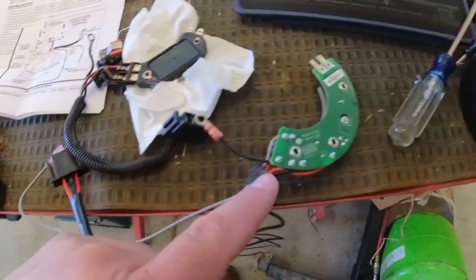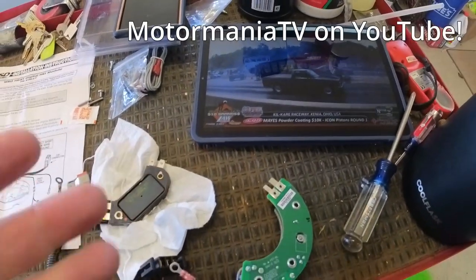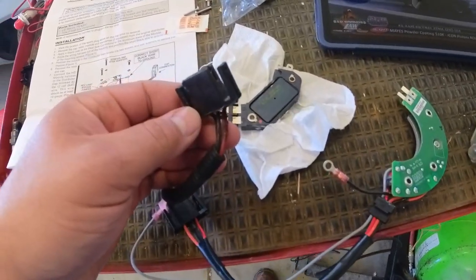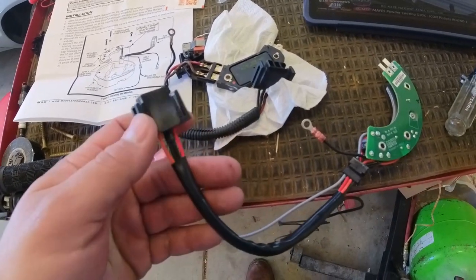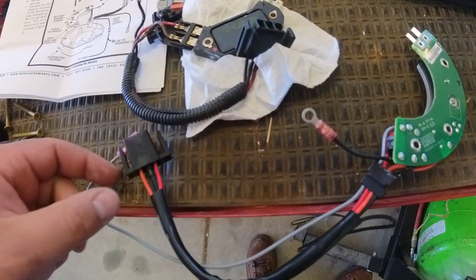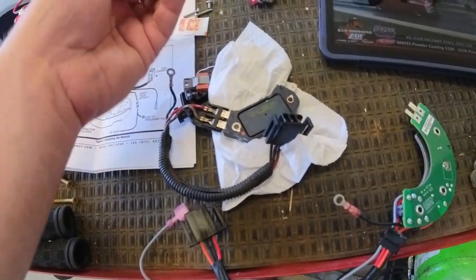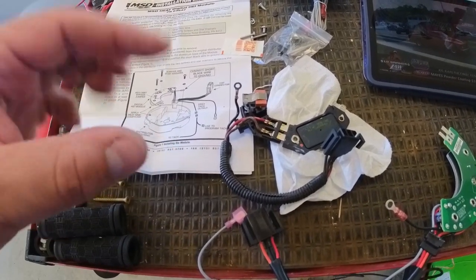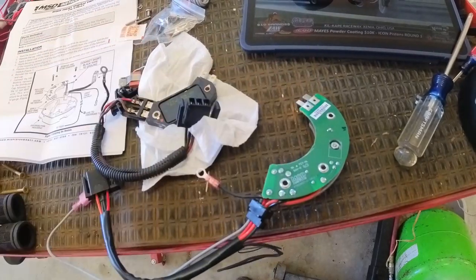I've got the old module and parts sitting next to the new one. I always like to compare side by side in case there's something glaringly different. Just making sure the connectors are the same — yes, there is some crispiness on the wiring here; this car had an electrical fire years ago, but no big deal. When you install this in the car, the red wire goes closest to the firewall. The connectors have spacing so it's hard to screw up at the cap. Good news: I'm already running the MSD low-resistance bushing on the distributor cap, so that's already taken care of. I'll spread the provided heat sink paste on the bottom and get it screwed down.